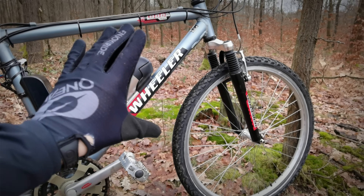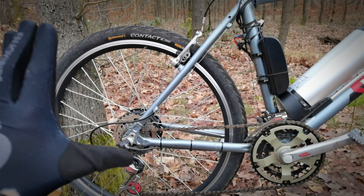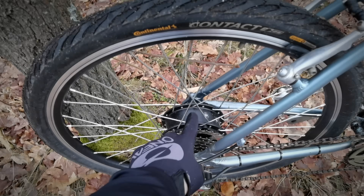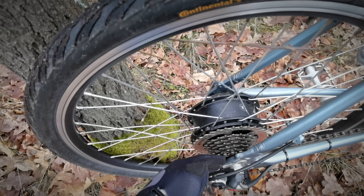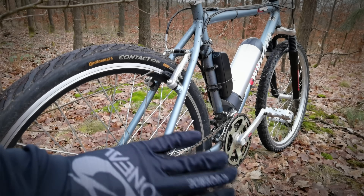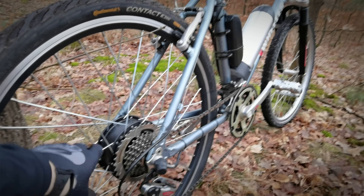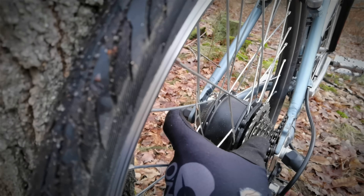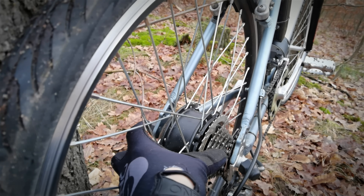Another thing: if you have the original bike on 26-inch wheels, you want to buy a 26-inch wheel with the motor. This is the rear motor conversion kit, meaning we are replacing the rear wheel with the wheel from the kit — it's got the motor in the hub. You also want to know the spacing between the dropouts, from here to there, because you want to know the length of the axle. These old bikes didn't have many standards for axles and dimensions, so it will be pretty easy to find the right wheel. If the axle from the conversion kit was a little bit too long, you can always stretch your frame a little bit.